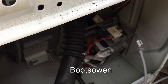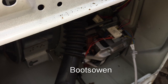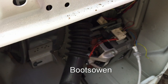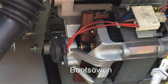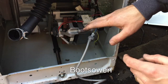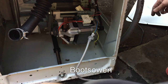So it'll either go or it won't — doesn't. Okay, plug it out. I've got my power on — should go. It went that time. Now what's happened there — we lost power in the house, I'd say. So that was exciting. Let's plug the earth out this time and try and get it to go again, because it worked but it just sparked, and I wonder if that commutator bar is a bit shook. I suspect it could be a dud motor, which for washing machine destruction doesn't bode well. So in here I've got it hooked up to a Variac — kept blowing the fuse, I think this motor's cooked. Just watch the commutator bar there. We lost it — probably blowing the fuse inside in the house. So it didn't actually blow the fuse, I'm not entirely sure what's going on here. Let's give it a couple more volts, maybe a hundred — no, there's nothing doing there.